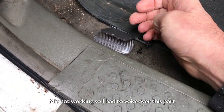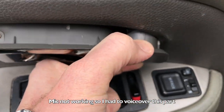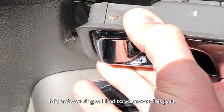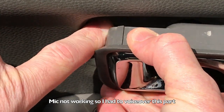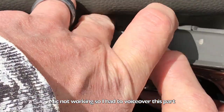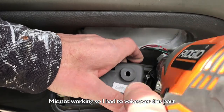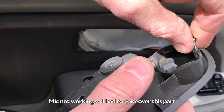Just to keep track of everything, I'm setting all the screws right down here in the floorboard together. After you get those out, this piece should just pop right out. There are two things holding it that make it a little hard: one is the button panel for the door lock, and the other is the actual latch rod. It takes a little finagling, but you'll get it out. Unclip the rod the latch is attached to by pushing the plastic piece off and sliding the latch downward off the L-shaped rod. A screwdriver can help it slip out. Now all that's holding it is the button panel — just two screws. Pull those out, tuck the buttons aside, and wind the screws back where they came from so you don't lose them.